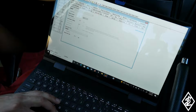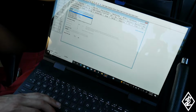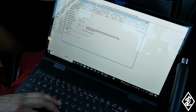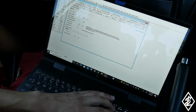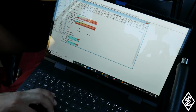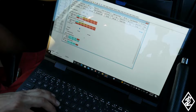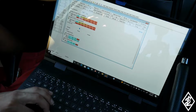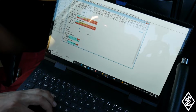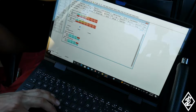Go and check launch control disabled. I'm gonna have to go ahead and put that on. And I'm probably just gonna set that to about, probably start off with like 3,000 RPMs. And I am later going to delete the IACV. That's the idle air control valve right here. You could use that. Disable IAC error. Definitely going to be using that in the future, probably soon if it's easy to adjust.